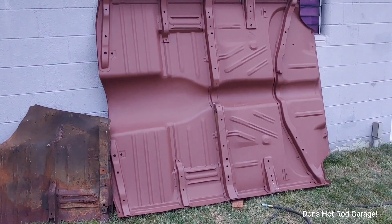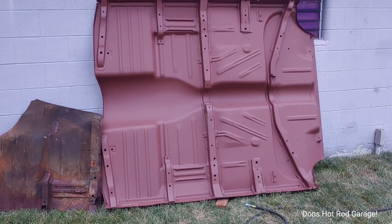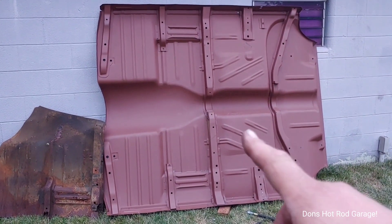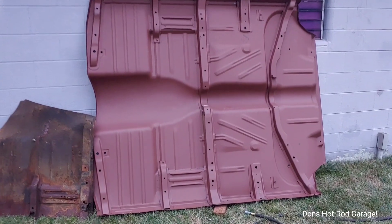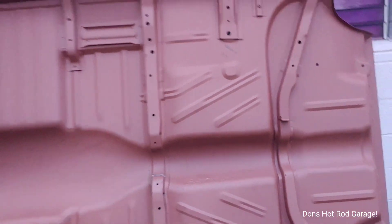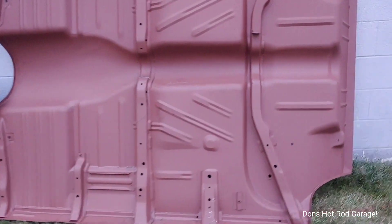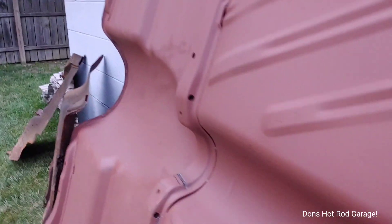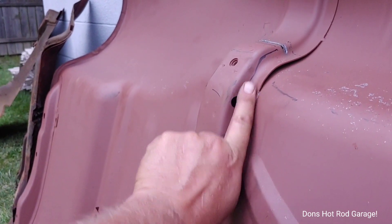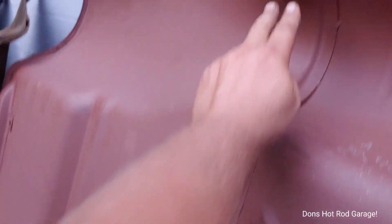It's just a little rant — these cars are an arm and a leg for everything you buy for them, and that floor wasn't cheap. Plus the time it took to go get it, the time I got invested taking the old floor out — for you to discover that that's all it is is a hard top floor with these braces welded to it. A convertible brace — that whole center brace through there is for convertible; that's a hard top brace. Look at how tall that stands up, and you just seen my finger where it wasn't even wide enough for my finger on the other one. That makes all the difference in the world — it sits on your X-frame in both spots on both sides up here too.